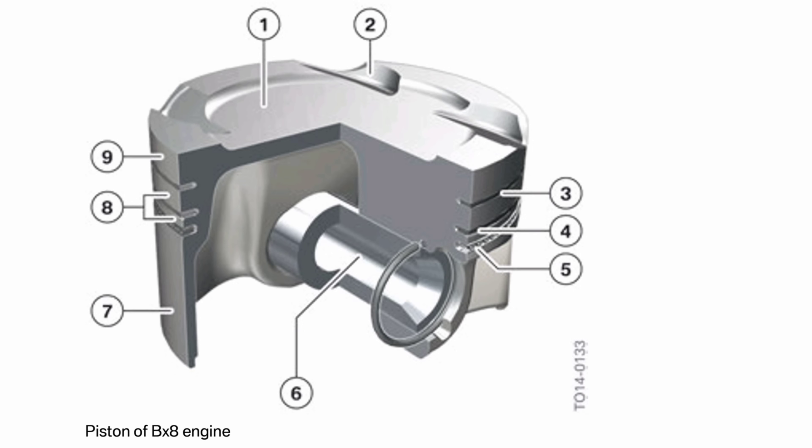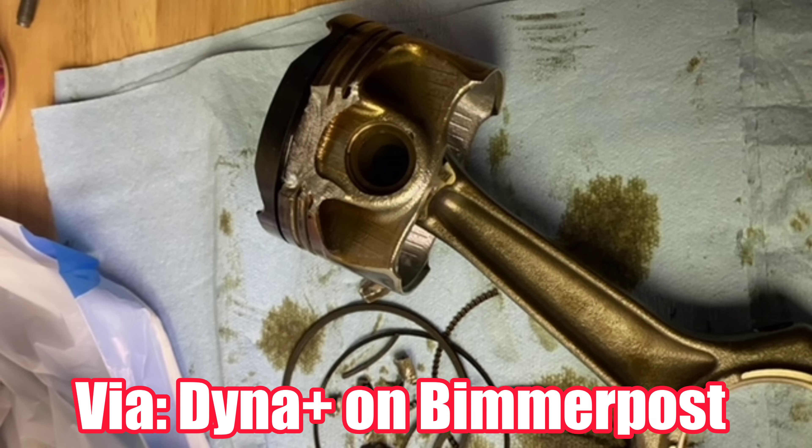Most aftermarket rods won't have that cracked feature — they'll just be machined flat and cut in half — but those rods have other ways of keeping them strong. From an OEM standpoint, the connecting rods seem to be extremely strong and capable since they're forged and machined well. On the other hand, the pistons are not forged, and just to be clear, that isn't the end of the world — the car can still make a lot of power. But it does seem like that's why pistons tend to be the weak point. A lot of people deal with broken ring lands or cracked pistons, so that usually is what goes out first.